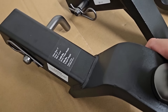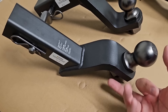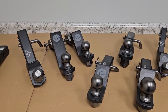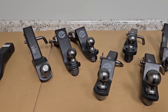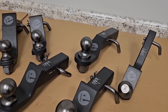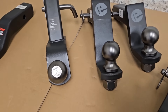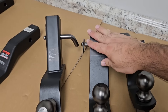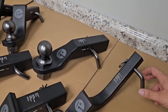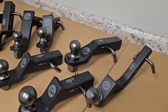This one is available in a two inch rise position, two and three quarter inch rise position, or a four inch drop. If you were to take this off, flip it around and put it on the other side you would be de-torquing it. So if you already know the size of hitch or ball you need and where it needs to be, this is a great option because it includes everything. They just look awesome — these things look beautiful with that black nickel ball and great protection. I even love the dark eTrailer stickers. These are pre-torqued, ready to go. They come with the pin and all the attachments — everything you need to get going aside from the trailer and your connections.